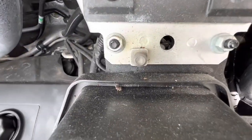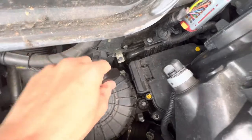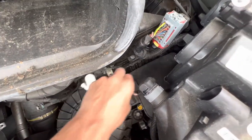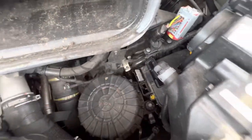For giving or receiving a jump start, earth off here, as the battery is underneath the cab floor. And then between the air filter and the fuse box is a triangular cover — lift that up and you've got your positive terminal for giving or receiving a jump start.